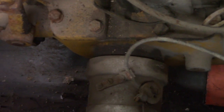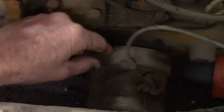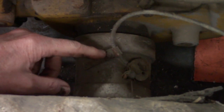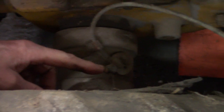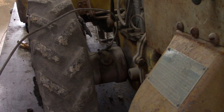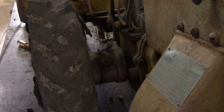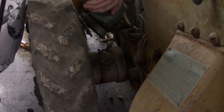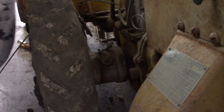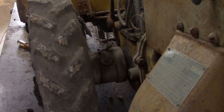Clutch hub cable will then go to this clamp here. There's a screw, bolt and nut to loosen that. Also a bolt here that attaches to the lever. It's usually hard to get to, so I ended up just cutting the cable off. Then I can remove the other wires once the clutch hub is off the tiller.